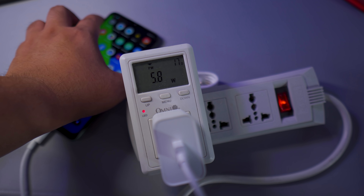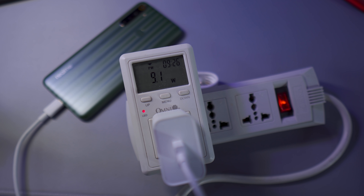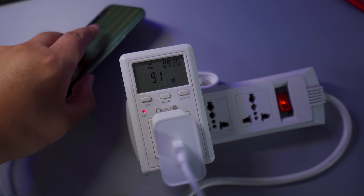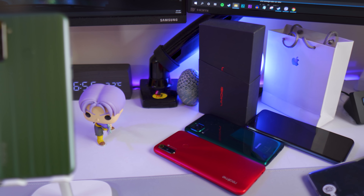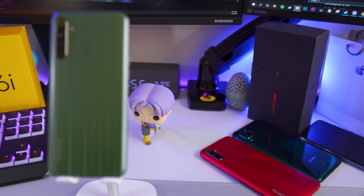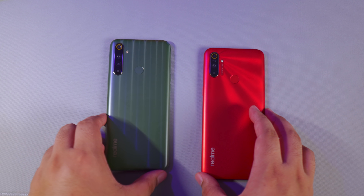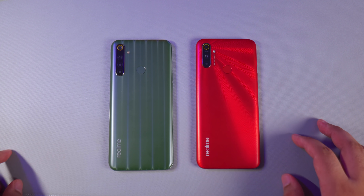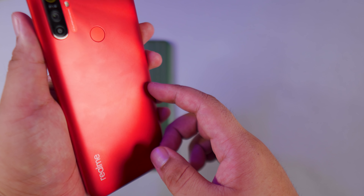Armed with a 5,000 mAh battery, the Realme 6i will last you for a day, and unless you game all day, you'll probably just need to charge it once a day. Now one thing to note that most YouTubers probably won't mention: while Realme claims that the 6i can charge up to 18W, the unit I got was only able to charge up to 10W — and I tried different variations of charging too, different cables and chargers, and I still got the same result. Hopefully it was just my unit, but it will take a lot of time to charge a 5,000 mAh battery at only 10W.